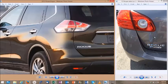So make that note, because on the N104PT systems, they have A chip style vehicles and B chip style vehicles. And all this information, by the way, is in Josh Heath's 2016 transponder book. If you're looking for a good reference as to which is an A chip and which is a B chip, that's a great book to go to, in section 2. You can look up the Rogue and any other vehicle in the Nissan Infiniti family to get that information.